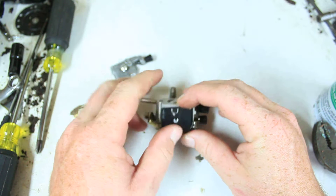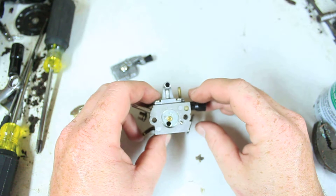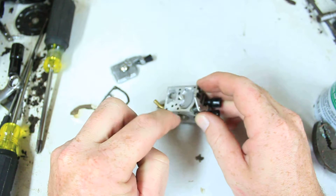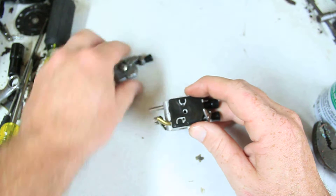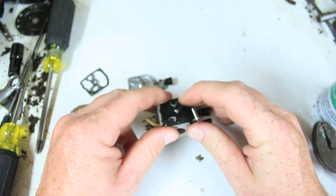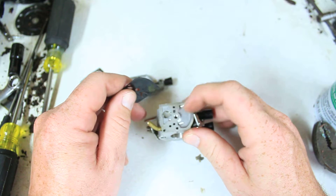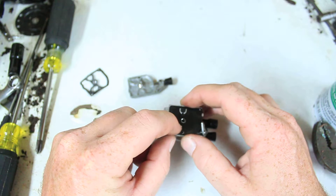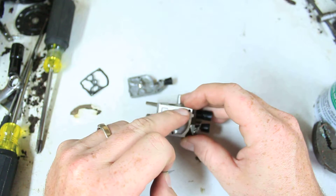When you're getting impulse coming from the engine, it's coming from this side — that hole right there, coming through and out of that hole. So this whole diaphragm is sitting there going up and down, sucking fuel from this side. It opens this valve, creates a suction, opens this valve, sucking fuel into this side. Then it goes into this hole, which goes into this body.